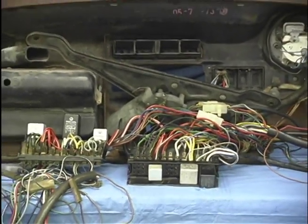Does this scare you? Well, wiring scares about everybody, but we're going to help you get rid of some of that fear with this video. We're going to show you where all those scary wires go. One thing to know is that all the different wires have a different color code. A bright red wire is usually hot all the time, a black wire is hot when the key comes on, the brown wires are ground wires, and all the wires that go to the switches usually have little tracers on them to identify them.